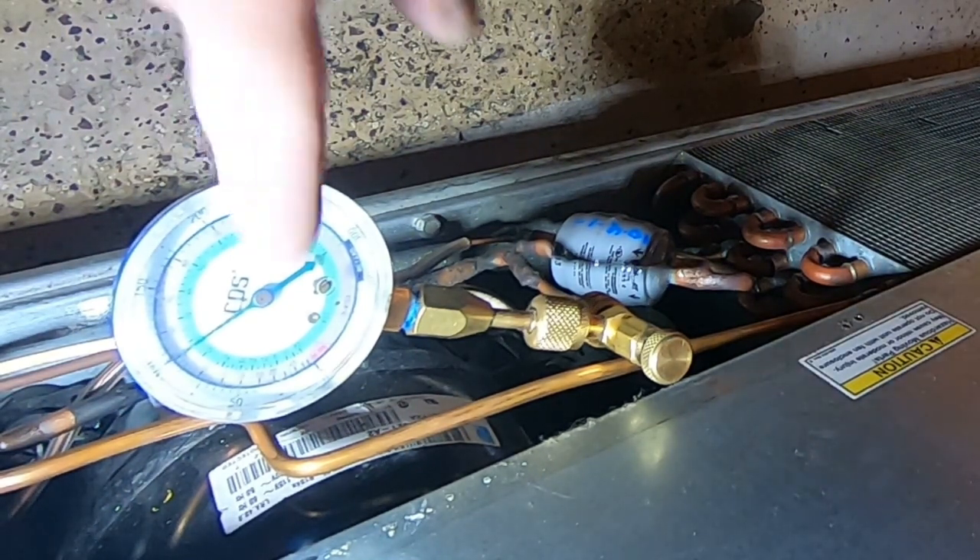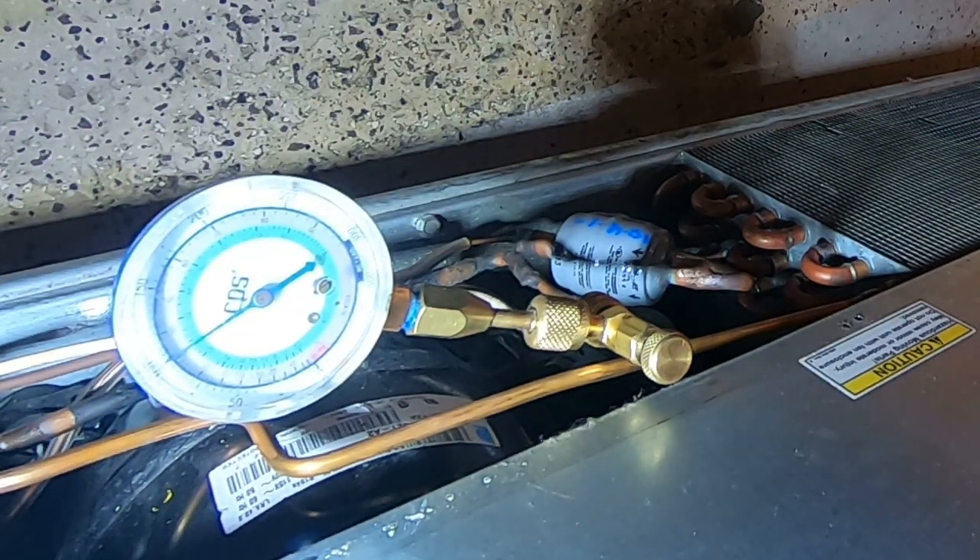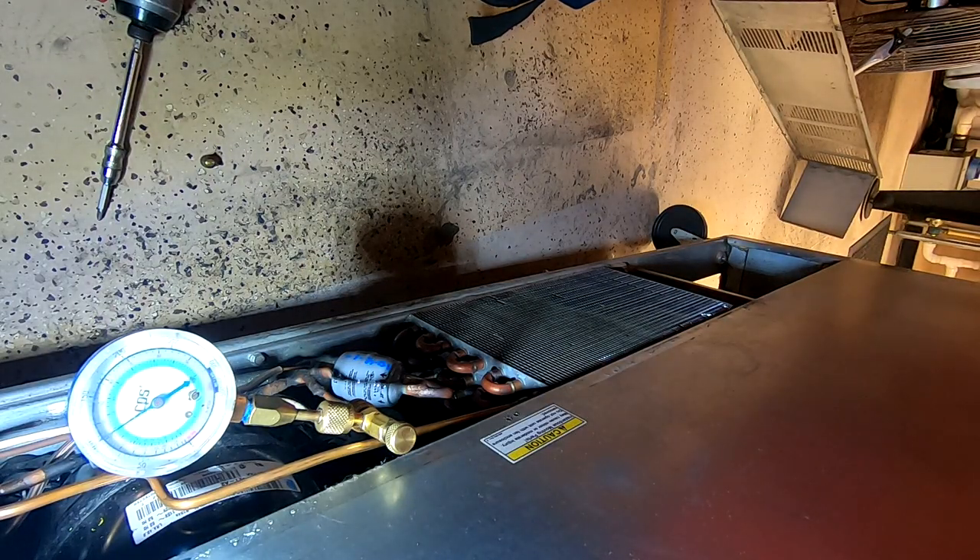It started to pull down and died out about 90, so I'm going to say it's having a hard time starting. That could be a sticking start relay, possibly not pulling the capacitor out. Of course, that would probably blow it up, so I'm going to go grab an amp meter and we'll bypass that start component and see if it works.